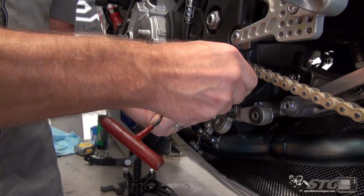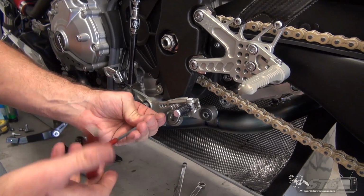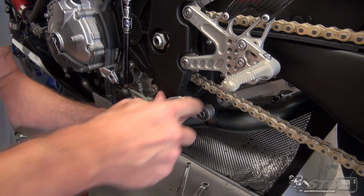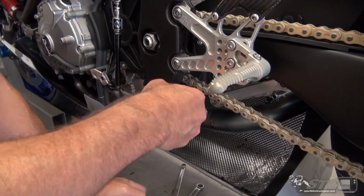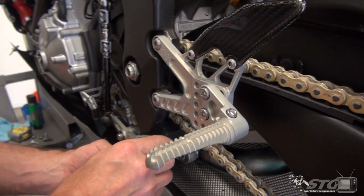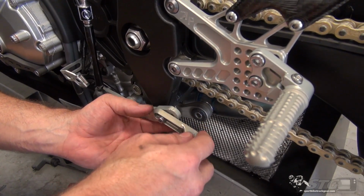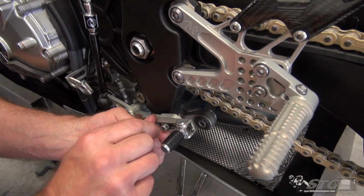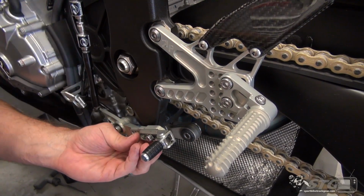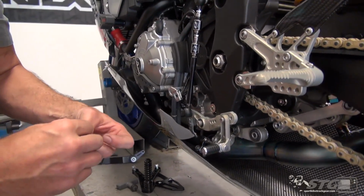Loosen those up, and you are able to relocate this thing. Let's see here, I'm going to have the bolts a little further out. It's kind of snug actually in its mount here, the tolerance right here, the grooves that it rides in. So even if these bolts become just a little bit loose, and that's some forward thinking by having these ledges here, it's not going to jump right over that. So these things would have to be epically loose before this thing started moving around. There's a lot of thought put into this.